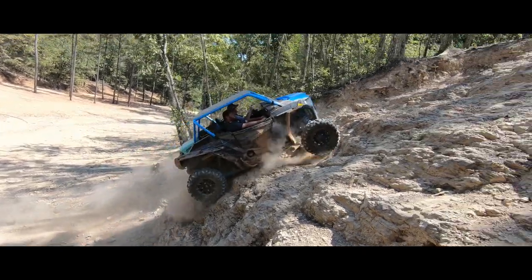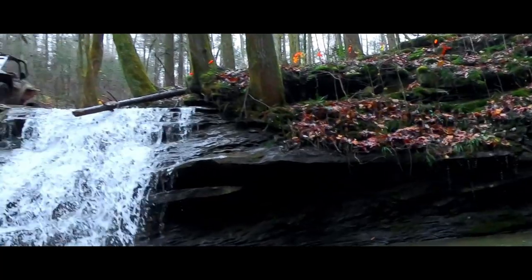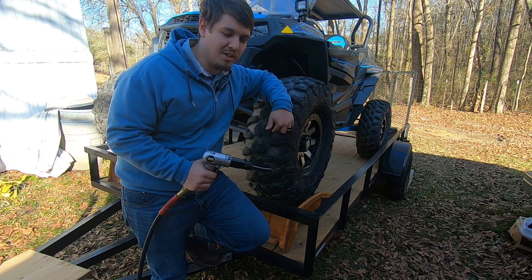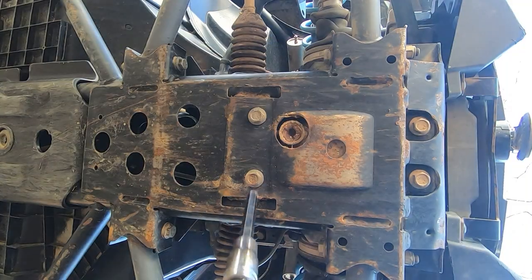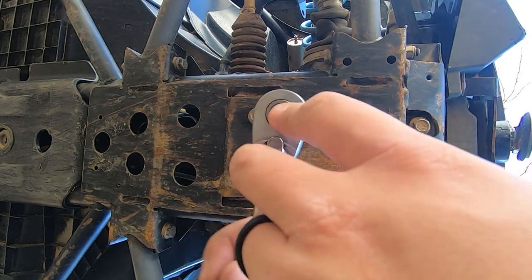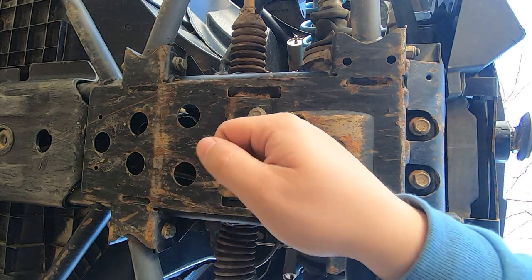You're gonna need this. Alright, silly intro aside, unfortunately I'm gonna have to use this to hopefully get my stripped front diff drain plug out. Let me show you what we're working with. Hopefully you guys can see from there — basically you try to put your correct 8mm Allen socket in there, and just due to the corrosion, rust, and everything else, it is stripped out.